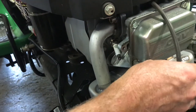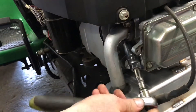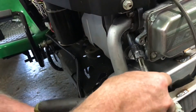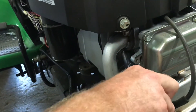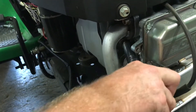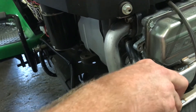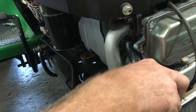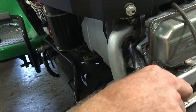You've got to be really careful — it's very hot right now — but I wanted to show you that. Now we'll take the spark plug out. We use a 5/8 deep socket — a spark plug socket with a 3-inch extension on a 3/8 ratchet. A 5/8 spark plug socket has a little rubber grommet inside which holds it in there pretty well so you don't drop it. If you drop your spark plug, you might as well just throw it away and get a new one.